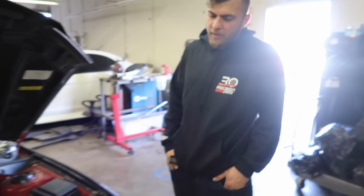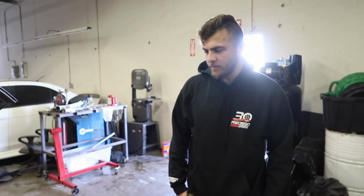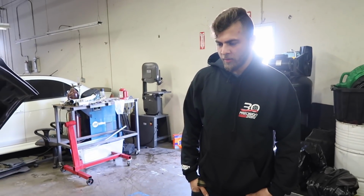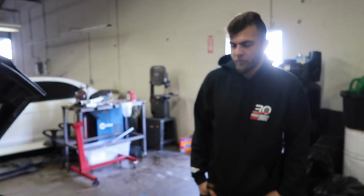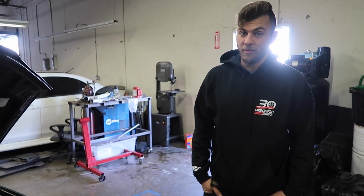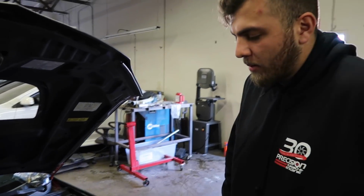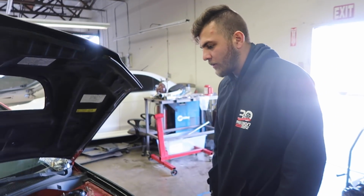Because if you go somewhere else, there's an altitude change, air gets a little denser or whatever, you might have 1 or 2 psi of boost creep. If you're pushing the car, and now instead of 52, it's 53, 54 pounds, your fuel system may be capable of handling that, but it's probably gonna lift the head.